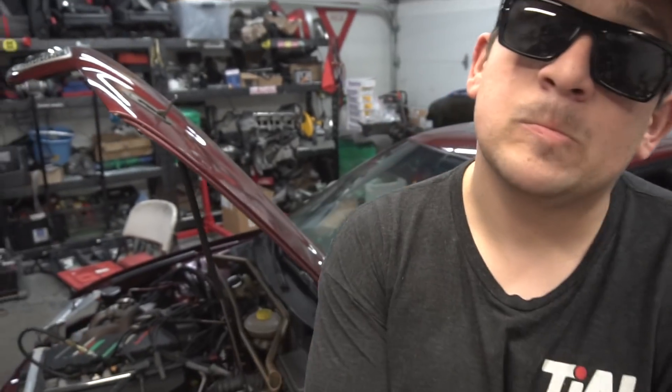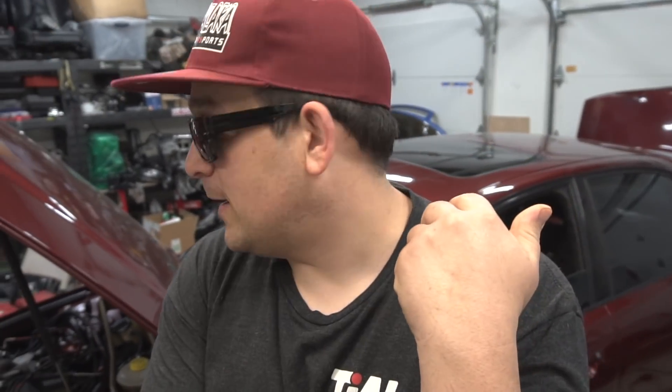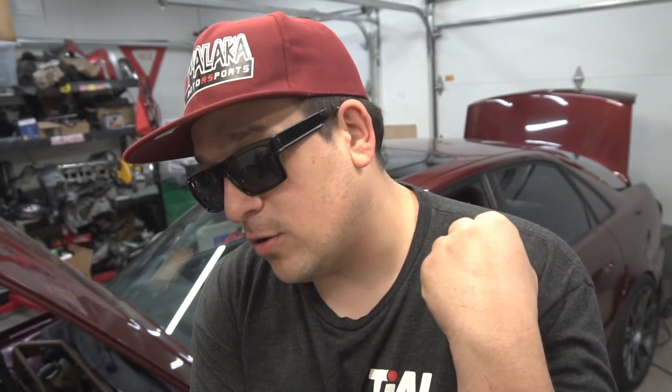So if you're wondering why we went from the dyno room back here in the garage — Stav, I'll let you talk about it since it's your car. We started on the dyno at a lower boost setting of 33 pounds. The car made around 430 to 480, bouncing between on the dyno. No matter how much boost we threw at it, it would never make more power. We took it off the dyno because we knew something was hurt.